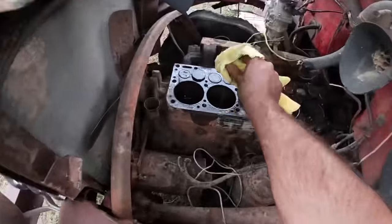That didn't sound healthy at all. Seems that cast iron wants to crack and we don't want that — it's all rusted out and real thin up here. We got that transmission cover plate off. It broke off from the trans and it broke the top of the plate — that ain't good, but we can fix it. It's really rusty in there; that's why it wouldn't move back and forth. The gears do have a little bit of rust on them.